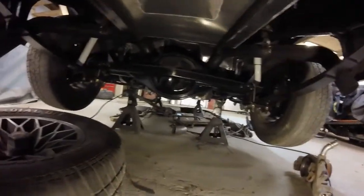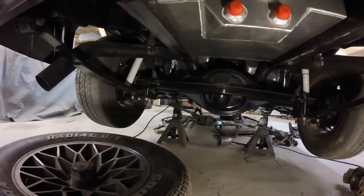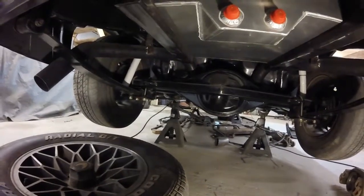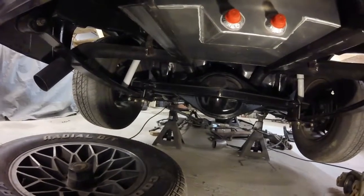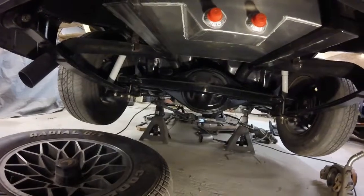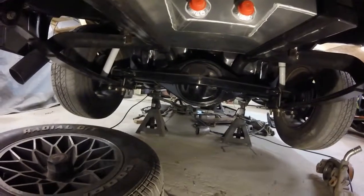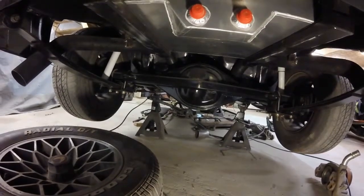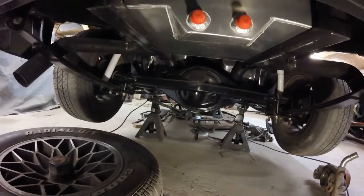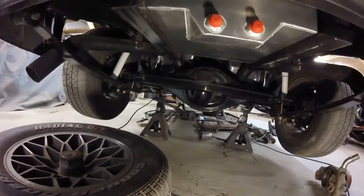So a bit of the back of the car. You can see the exhaust going back there. It's a 9-inch Ford, back braced. Right now it's 33 spline axles, which I will have to get rid of, because apparently nobody seems to make a cheap locker for 33 spline. They all make a spool. They make it for the 31 to 35, but I think only one manufacturer makes it, and by the time we get it here, it's like $1,000 to $1,500. It's quite expensive.